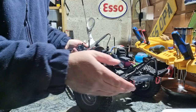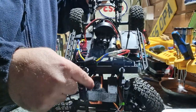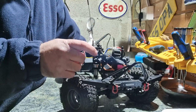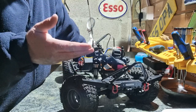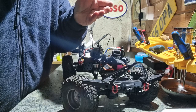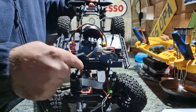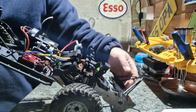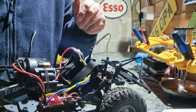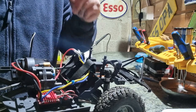The person who bought me the wheels also asked if I wanted a battery mount fitted up here next to the steering servo. He asked if I wanted one made and I said yes. So now I can fit my short pack 1500mAh 3S battery pack at the front to give a bit more weight where I want it. Otherwise, if you didn't have that, there's a spare slot where you could fit another servo — like a winch servo — right next to the steering servo, so there are actually two servo slots there. The battery tray is where the battery normally mounts, but I move it slightly more forward for a bit more weight, and I left it there testing with a slightly bigger battery for longer running time.